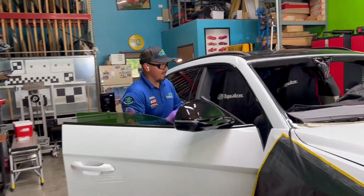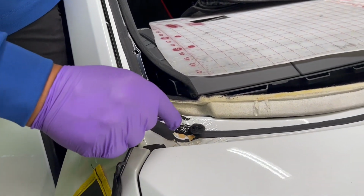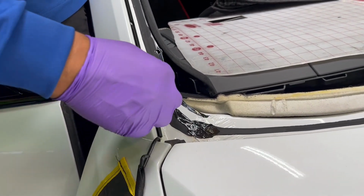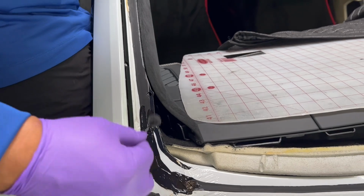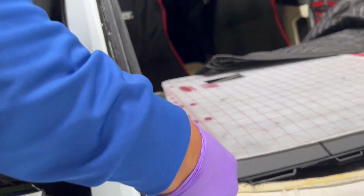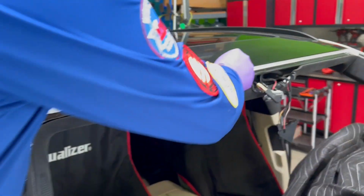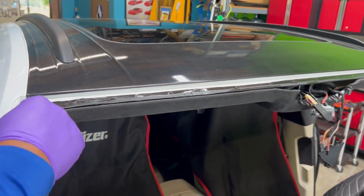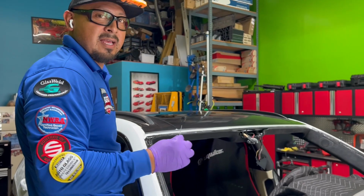Guys, something very, very important. You have to primer. It's not an optional step. It is a step that has to be done. And from all the urethane manufacturers that I know, if you go down to bare metal, with the urethane manufacturers that I use, I have to put 2 coats, 2 minutes in between. I do want to point out how important this is.